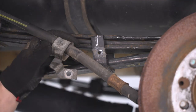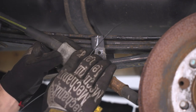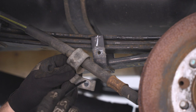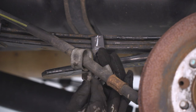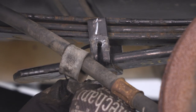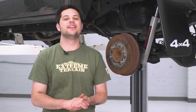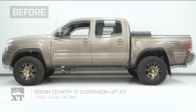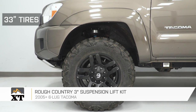Finally, the last step — this is our e-brake cable bracket. With the lift block installed, there is no slack left to get this bracket up there and tightened down with the original bolt, so we're gonna break out the old zip ties here and just keep this from rattling around. The install is going to be the same exact thing on the other side. That is gonna do it for the install. Highly recommend after doing this to your Tacoma to drive right to the alignment shop. That's gonna do it for the Rough Country 3-inch Suspension Lift Kit, fitting all 05 and newer 6-lug Tacomas. Thank you guys for watching — subscribe for more videos like this one. Keep it right here at ExtremeTerrain for all things Tacoma.